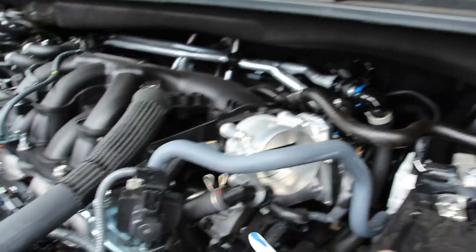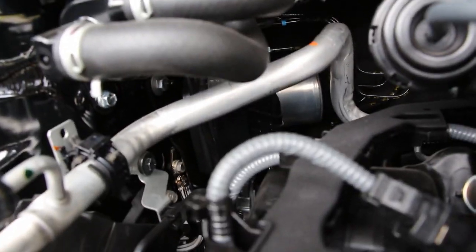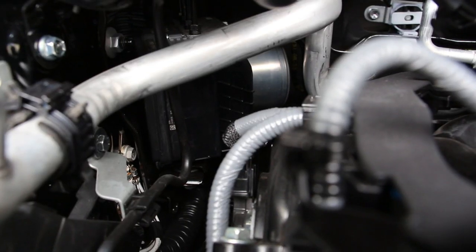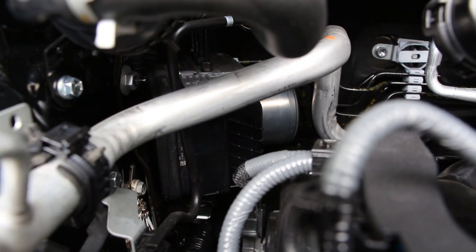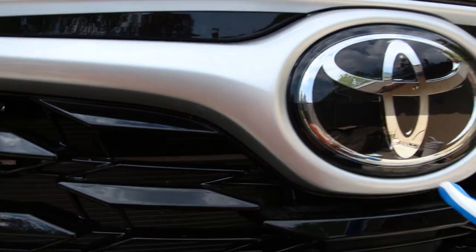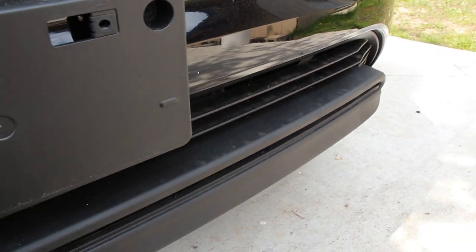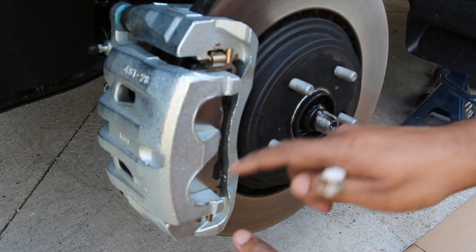This is something you'd typically see in more efficient hybrid designs or turbocharged engines where vacuum from the intake isn't enough to drive the braking system, but in this case Toyota chose to do it even though it's naturally aspirated. The master cylinder then feeds your ABS actuator located way down inside of the corner there, behind this auxiliary water pump. That ABS actuator is responsible for your autonomous braking features as well as your regular traction and stability control. I like that Toyota is using its emblem for the front radar as well as sensors up high in the bumper, as opposed to down at the bottom where they could be subjected to off-road damage.